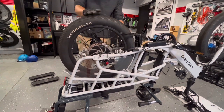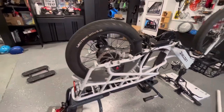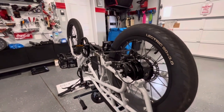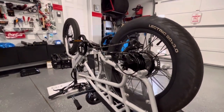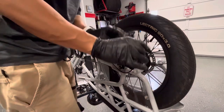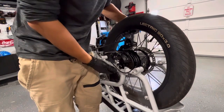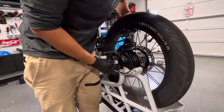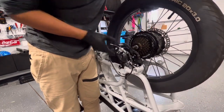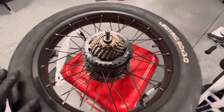Just making sure it's loose and able to come off. We'll bring the camera to this side because the chain is going to be the difficult part. Ideally I'm not going to break the chain off and have to reattach it — I didn't have to last time so I'm going to avoid that again. Make sure you're wearing gloves so you can pull the chain off without bending anything. Be very careful with the derailleur. And now we have the wheel removed from the bike.